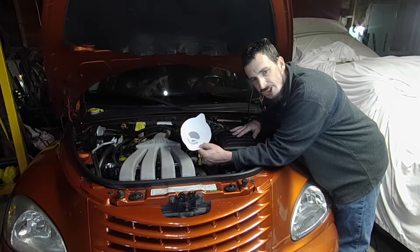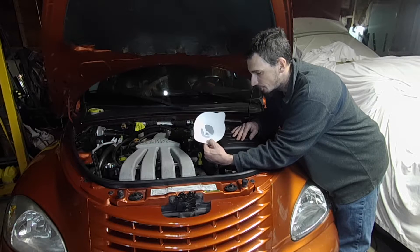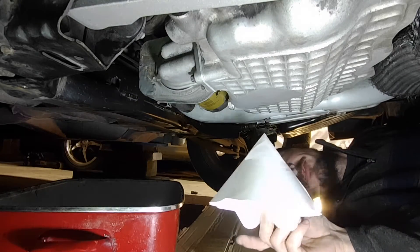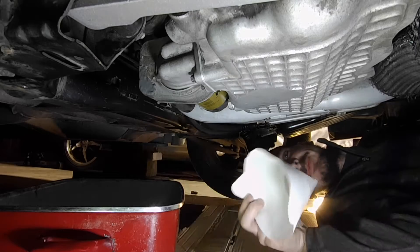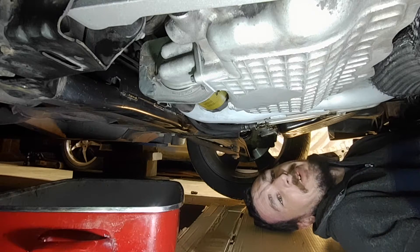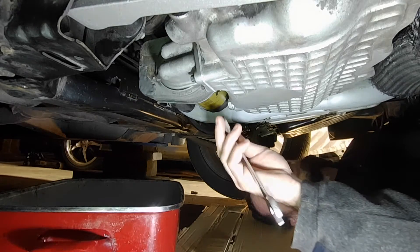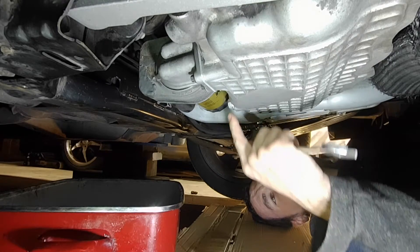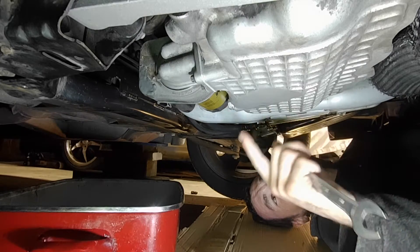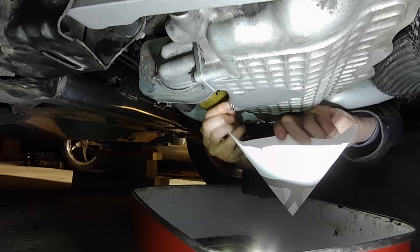I've already warmed up the engine, so we're just going to jump underneath, drain the oil out through this, and I'll show you as we go and whether we catch anything. I've got my drain pan, I've got my funnel, and I'm going to hold it over the drain pan. It's important to have pretty clean hands and for the undercarriage of your car to be relatively clean, otherwise you could end up with debris that might confuse you and make you think you had debris in your oil. This is 18 millimeter — I think somebody swapped in an oversized plug because they were never that big originally, there should just be a 13 there. I'm going to get that drain plug out and put the funnel under in one swift motion.